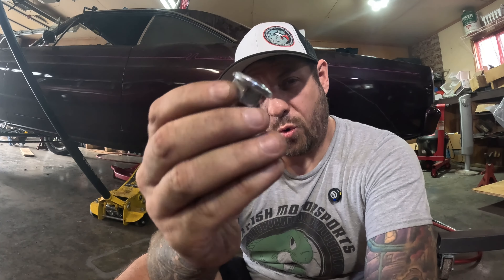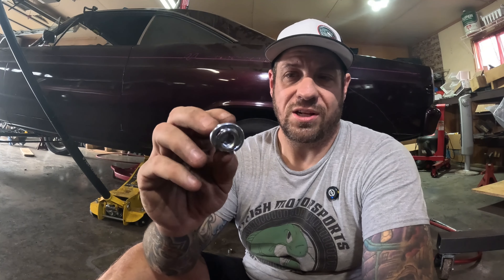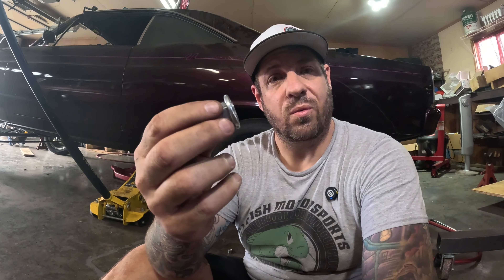I made up my mind to go ahead and torque down to 75 foot-pounds. I got it down to about 50 foot-pounds and all of a sudden it got looser than it should have. I thought I stripped out the bolt, but it turned out the super chintzy lock washer had just slid all the way around. The hardware on this is not the same quality as the JEGS one I used before, but this is pretty easily remediable. Just grab some grade eight half-inch lock washers, and I'd probably put at least one if not two normal washers under it because you do sort of run out of threads.